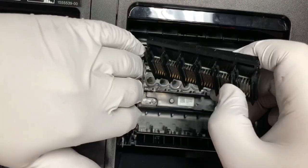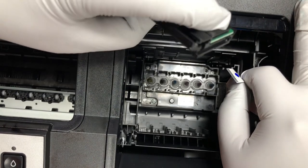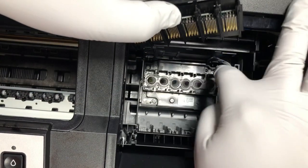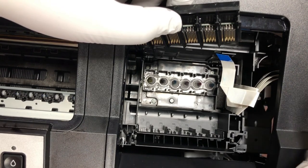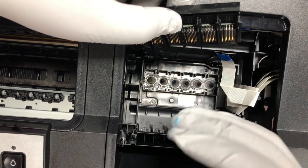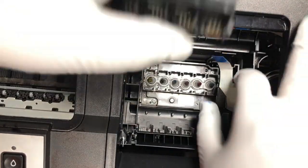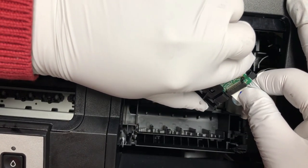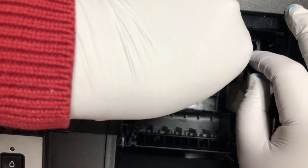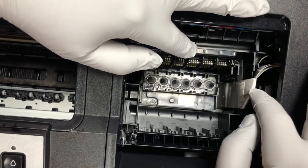Now the chipboard — this chipboard disassembly is often really loose. There are lots of times you put it in and the chipboard knocks off, and when you turn the printer on it says there's no cartridge. If that happens, you want to test whether the cable is loose or something is wrong with the chipboard. Take your CIS out and put the original Epson cartridge in. You don't need to pull all of them — just put one or two in and see if the printer can recognize them. If it does, you can focus on troubleshooting the CIS chip.